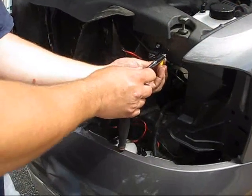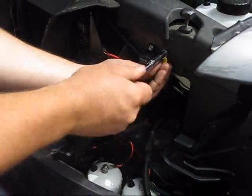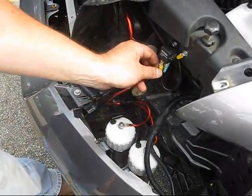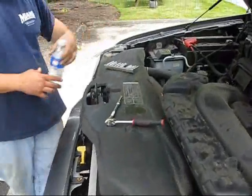We took the one black wire off the sensor on the mix tank and put it to the blue wire on the switch box. The other black wire on the sensor just goes directly to ground. The wire that goes to the battery I've just routed up through here, runs all the way across the truck, and it's up here at the battery.